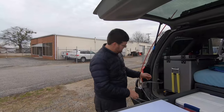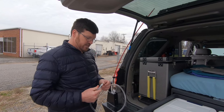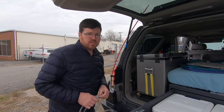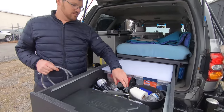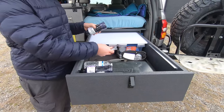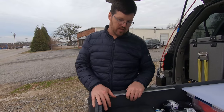The water outlet is a quick disconnect — it's very similar to a CamelBak fitting, made by a company called CPC. People actually use these fittings for home brewing equipment. For the drawer system I'm running Accuride 500-pound sliders — I wouldn't go with anything else. Three pairs of them, and they actually came used from police cars out of Los Angeles. There's a little piece of aluminum here to slide up the cutting board channel and get the cutting board out of the way.